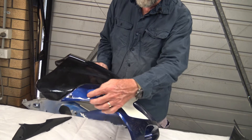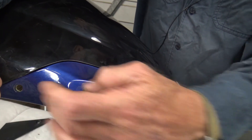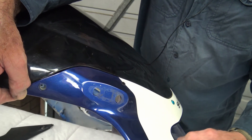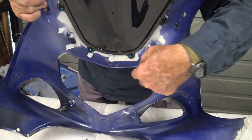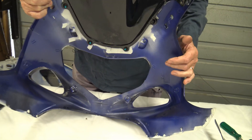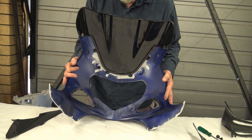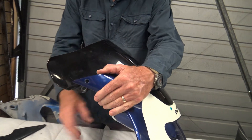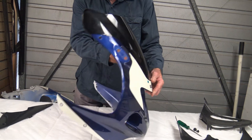Removing the headlight cowling: there are three screws at the top that need to be undone — one, two, three. These two actually hold your mirror on, so you need to take your mirror off before you can pull the headlight cowling off. Same on the other side, another three. The headlight itself has lugs at the back that lock into the fairing frame, and when you go to take it off you do a direct pull forward and that will pull those two lugs out of their rubbers. Sometimes the rubbers come with them. You will also need to disconnect the cables — it's good to have somebody to hold the headlight cowling while you do that, or you can just balance it on your knee.